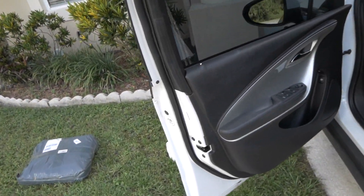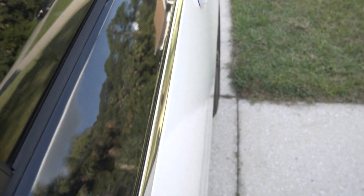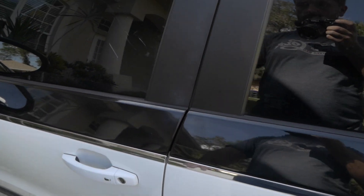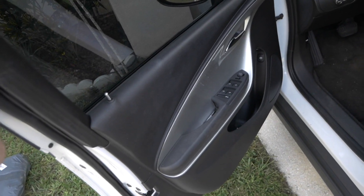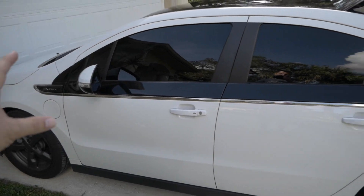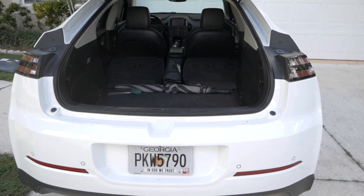Later when I unlock it with the key — because it's the only keyhole you've got to get in the car — I'll open the door by pulling on the lever, which unlocks it, open the door, reach in, pull on that, and connect the terminal. Make sure you don't lock yourself out — don't leave the keys in the car, because there's no more power and you're going to get locked out. Disconnecting the car alleviates any electrical problems; it's completely disconnected from any computers and electronics and should be fine. Whenever you're ready, just close the trunk and that's it.